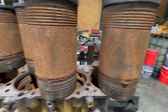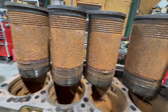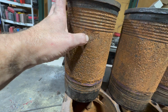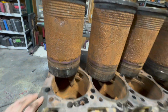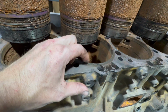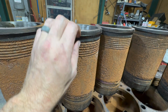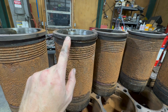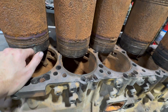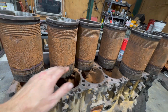These are aftermarket liners. The bearings were PAI. I was very surprised to see this engine had been into before. That erosion on there. This block has been cut for counterbores. See this little lip right here? That's for a stainless steel shim, which are still on the flange of the liner, to set right on top of the block in order to raise the liner height up.